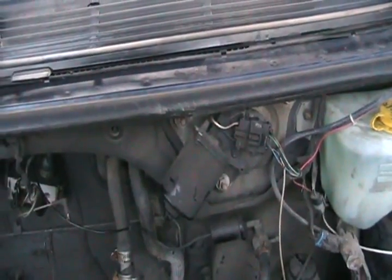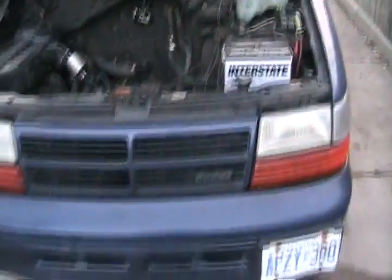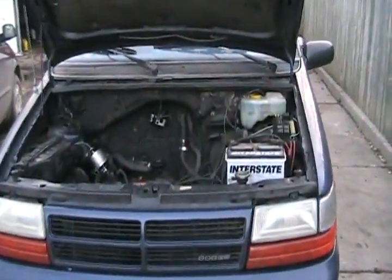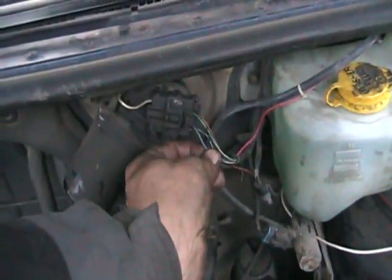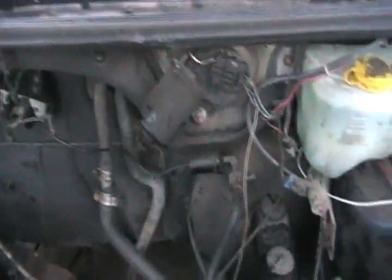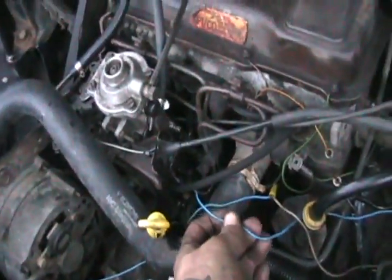So I guess I just had a brain fart a few minutes ago and said to myself: why is it running so perfect when you push-start it, but there's no way — even when it's hot — can you key-start it? Then I thought to myself, I wonder if all the power shuts off to there during cranking — and it did. Well, that makes no difference for an alternator exciter in that circuit.